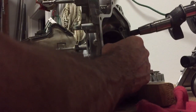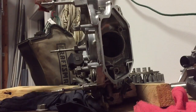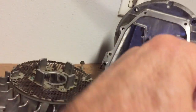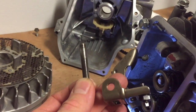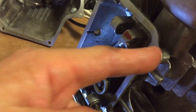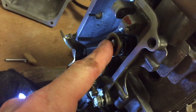Once you do that, you can take this crankshaft out, and then you will remove the piston, and that is going to expose the valve in question, which we're going to take out. Once you get to that stage, you can take a look in there, inspect it, and then you are going to remove this outer portion here with a pin that just pulls out. That's going to take this cam lever off and expose the valve spring. This basically pushes in and just releases, and then you can press the valve through the back out of the hole. If for some reason it's stuck, you may have to tap on the valve end with a little hammer.